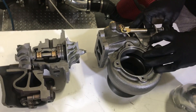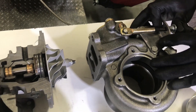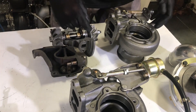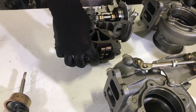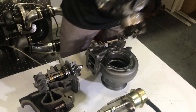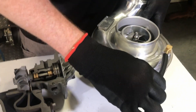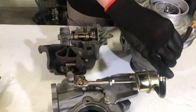Here's a spring gate. The difference between a spring gate and the boost gate is how it opens. They both open the wastegate the same, but a spring gate does it off of exhaust pressure exerting pressure on the inside of the valves, where a boost gate operates off of boost pressure where it would normally be connected to the turbo. And that's essentially how a wastegate works.